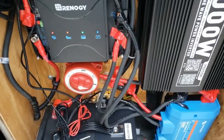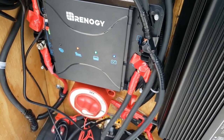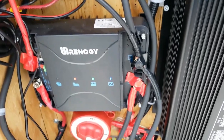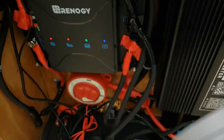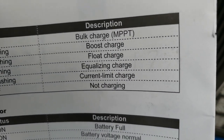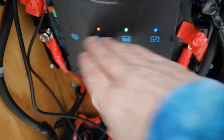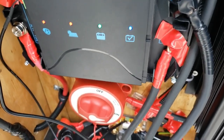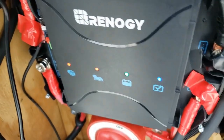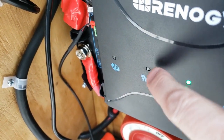Going back to the manual — which I find quite easy to read and use — there are two pages I always pay attention to. All four lights are on one page, and it shows what each light does and what the code means. I don't have to go searching through every page. Right now I've got solar coming in — that's what that light means. If I turn off the solar, it cuts off and it's no longer charging my starter battery because I have nothing coming in.